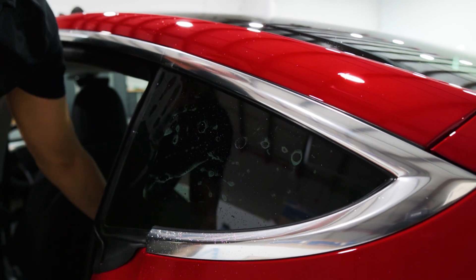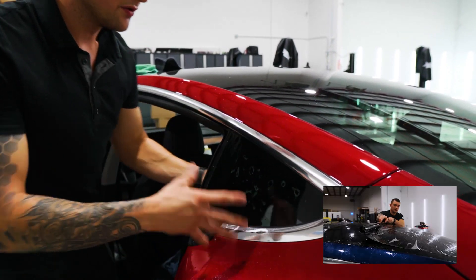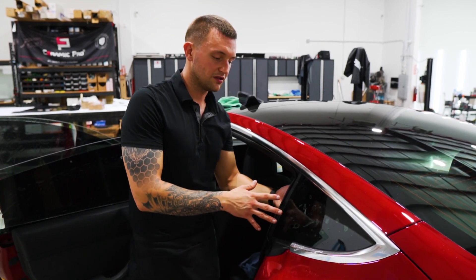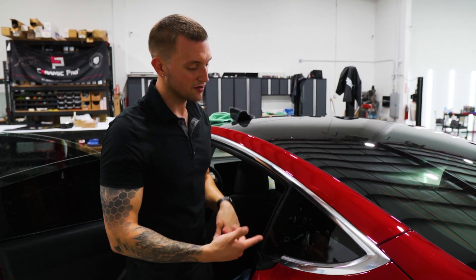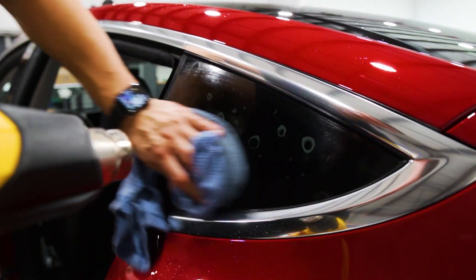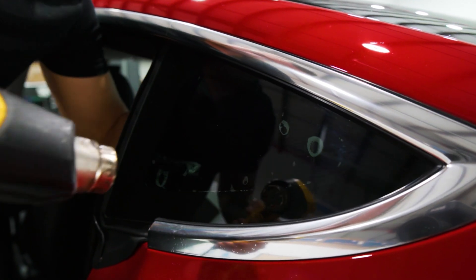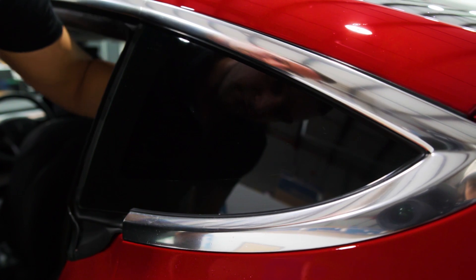For the sake of this video I'm only doing the side windows, since there's a separate rear window video for the Model 3. But if you're doing the full car, take the side panels off the interior — it'll make access to the quarter windows a lot easier without hitting those panels. After you take the panels off, tint the quarter glass windows so you don't cause contamination. Once it's laid in place, heat it up from the outside so the first squeegee stroke mounts it and it won't move. Start lightly in the center, and now it's mounted and won't move around.